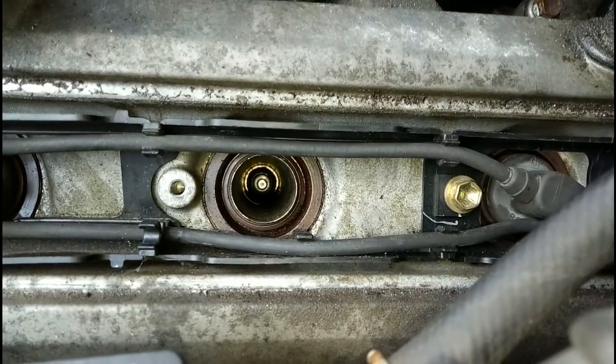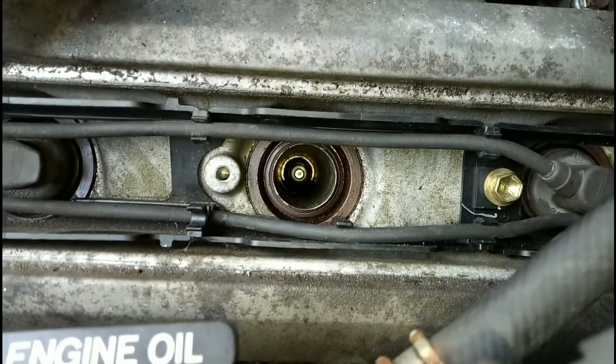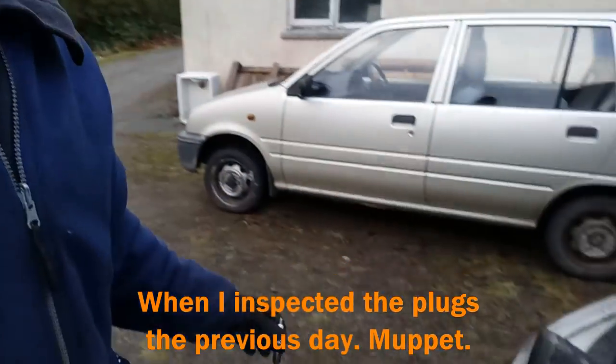Today's incompetent user with crap tools moment: my little socket for the spark plug usually has a bit of rubber so it'll snug around the top of the plug and pull it out, but when I pull the socket out the plug does not come out. So I get the HT lead, stuff that down there, give it a jiggle, and out comes the plug. I also noticed oil around that one, which suggests the cam cover gasket is leaking and dropping a bit of oil into the cylinders. Then the rubber from my spark plug socket ended up stuck down in there - it took me an hour to get it out, involving a vacuum cleaner and stabbing it repeatedly with a screwdriver until it broke up enough.